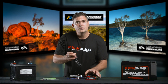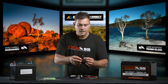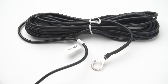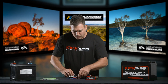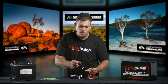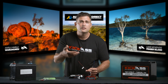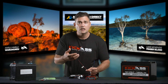This charger will also compensate and adjust for different temperature conditions. To do that, this long cable here will go to the negative terminal of the auxiliary battery that you're charging. There's also a couple of other wires here. One of them is a LED light — if you wanted to run an LED light in the dash of your vehicle, you could connect the positive from this, then connect the light to an earth source as well. That'll flash when the charger is charging.